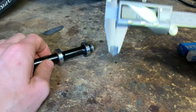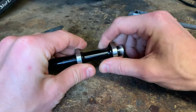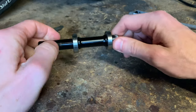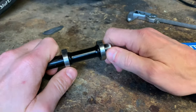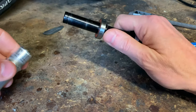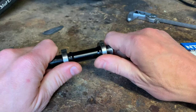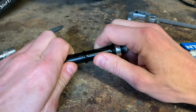So now I've got my measuring device, I've measured all of them and I've sent the details and the measurements back to Hambini. I've said sorry, I think I've made a big mistake, because I was assuming that since the front ones were 6903s the back ones should have been 6903s too — so I sent all the bearings back. Now I've got 6903s that I thought would fit them all, but they're actually non-standard and I need 6903-18s. He said yeah, don't worry about it — the cycling industry is not known for using standard sizes.